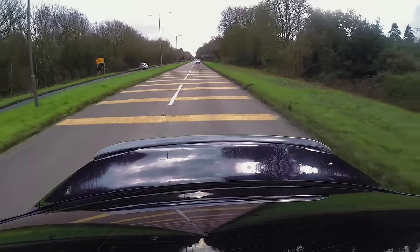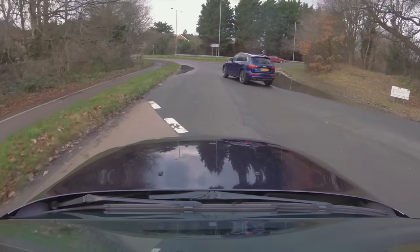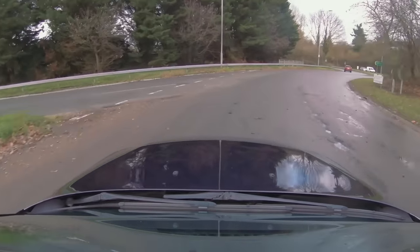That Walton Motorsport manifold, man, they're like the best you can get, mate. Because it was running a log manifold before, the amount of back pressure on it was fucking unreal. So obviously we went with that equal length twin scroll, managed to get like an extra 200 foot pound of torque, man, just out of that manifold alone, mate. Serious?